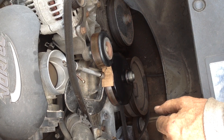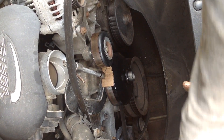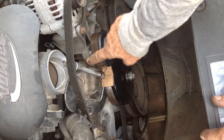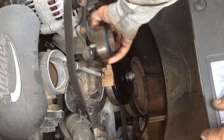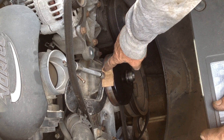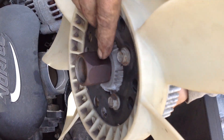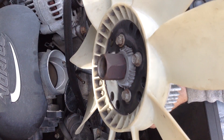There are several different ways of holding down your main water pump pulley. I tried to use a gigantic pair of channel locks and wrap it around the pulley, but they were just not big enough. So I used the clamp method instead. I removed one roller pulley to have more access, then used a piece of cardboard clamped down on the pulley and wedged it up against the water pump to keep it from moving. Then I used a pipe wrench on the main nut to get it off.